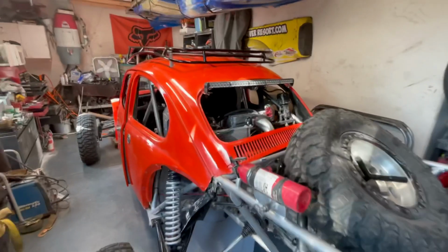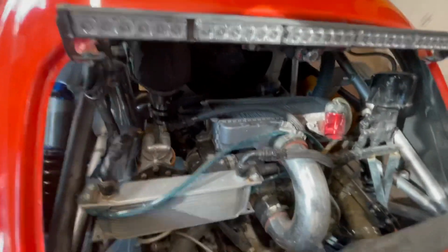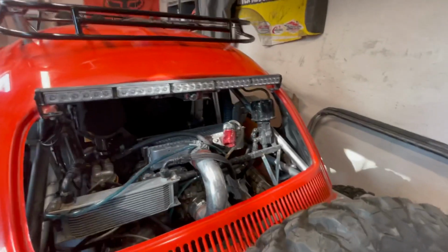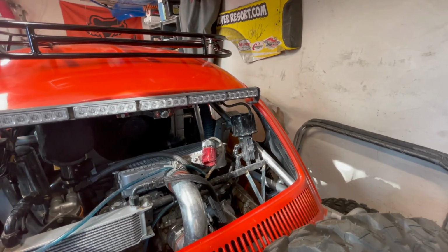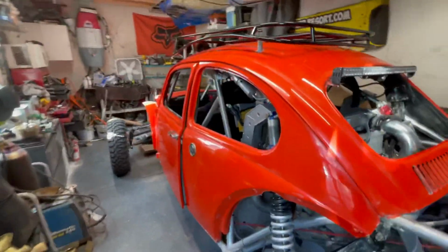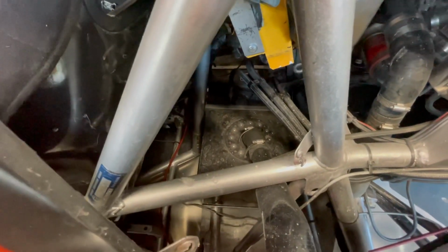We move around to the middle. So full Subaru intercooler. It's got an aftermarket blow-off valve, which honestly is cheap. It's got the K&N reservoir over the catch can over there, K&N air filter, oversized aluminum radiator. I think it's a dual core. Let's see, inside here, we've got the 15-gallon fuel cell with foam in it.